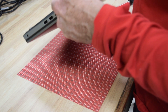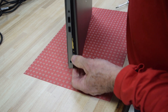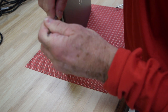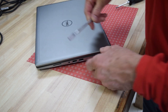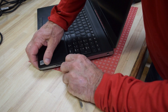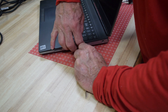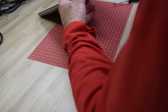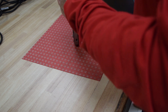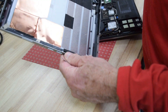It's just two pieces of plastic snapped together. There's always that tendency to try to be careful, but you can see there it started to come apart. Just get it in a position where you can pry. You could use a screwdriver — just be careful you don't touch any electrical components inside. Usually I get started at one of the corners, find an opening between the two pieces and pry them apart. There we go — it just snaps off.